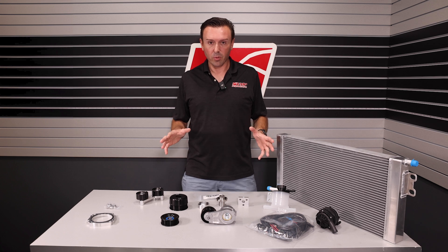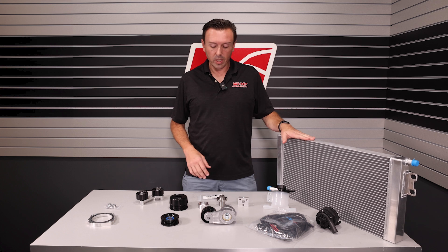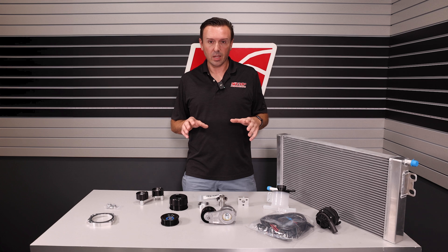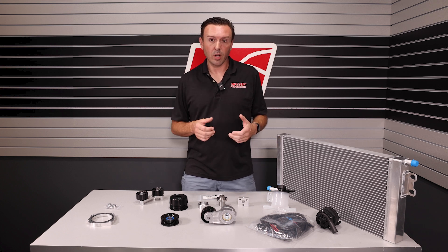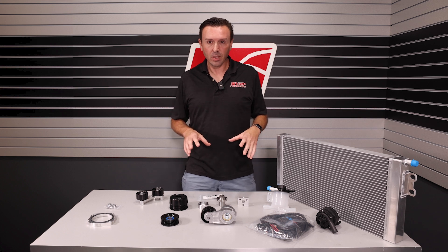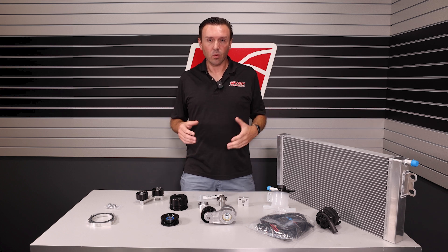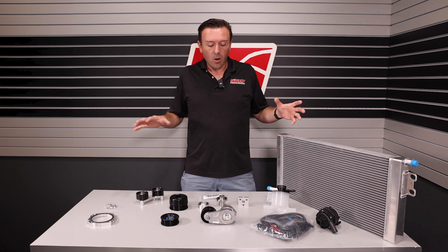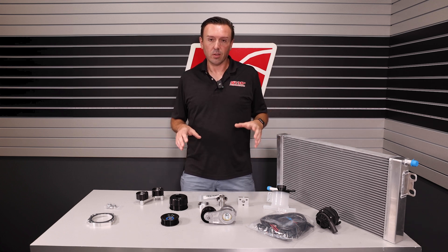That's pretty much it for the Predator swap base package. I think I covered the most critical areas: throttle body, cooling, and belt drive — this is going to get you started. Check out our guides for some of the generation-specific harnesses and spacers to lift the blower up on a Gen 3 if you're going to do that. And for F-150 — if you want to see some F-150 specific packages because the belt drive is different, drop a comment below and we'll work on getting those together for you. If you already have some parts or pieces, all these components are available individually on the VMP website. We just wanted to package them together to make it easier.